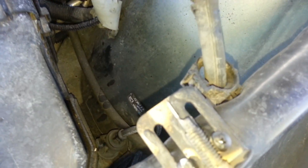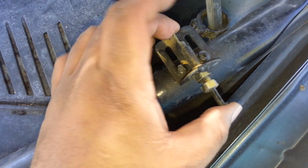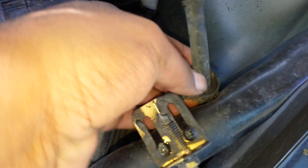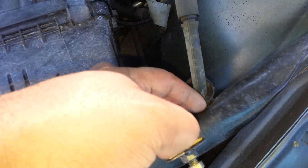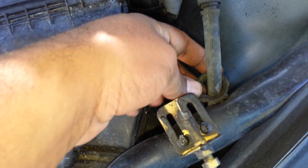One thing to point out - you've got this here which clamps in, just holding this cable. Keep in mind when you pull that out - this is just for my alarm to hook in. Just make sure when you pull it out you're gentle, get a flat head and just pull that right out and it'll come out no problem. That's one of those standard rigid plugs, so just pull that out and once you get that out you can get the bar out of the way.